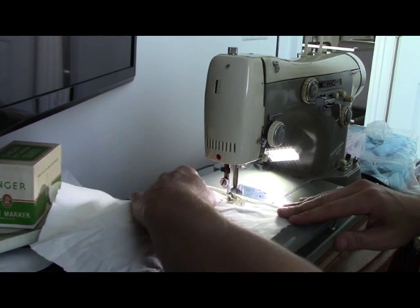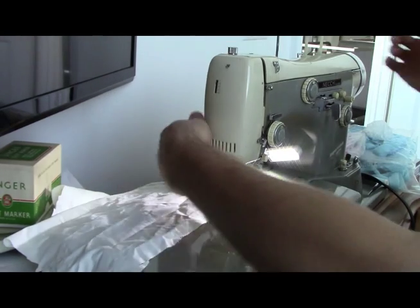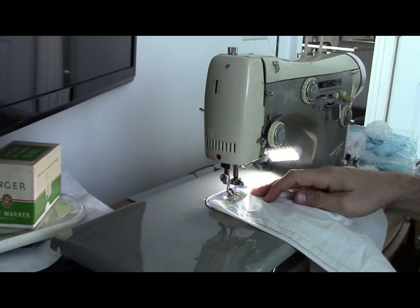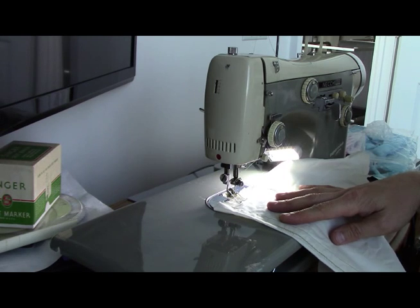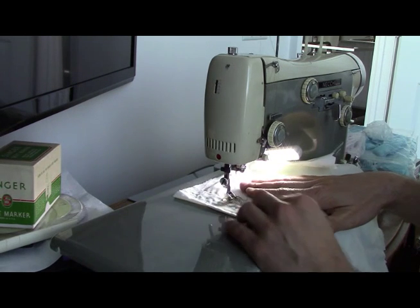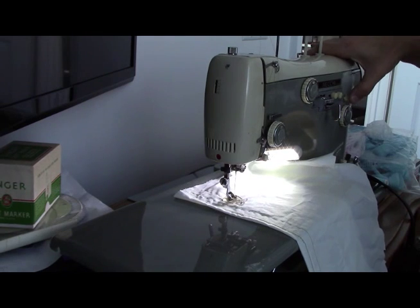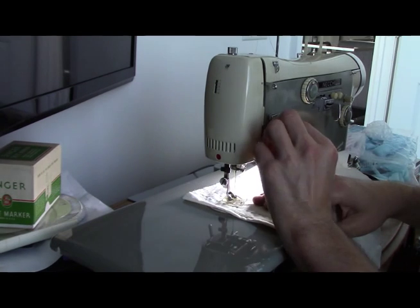So now it's quite good, it works very quickly, and we're getting good success. And I found that the belt was quite old, so I've ordered a new belt as well as a new light bulb because it's quite loose. And it's pretty good. It's not 100% straight, so I probably need to make a little adjustment on the mechanism so it gives perfectly straight stitches, because it should give perfectly straight stitches. But I can live with it, and I've replaced the spring with a lighter weight spring so that the reversing mechanism works a little better.